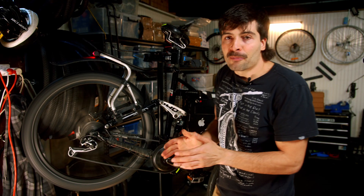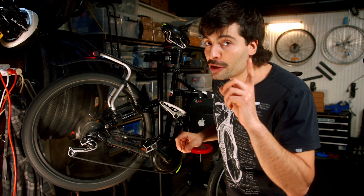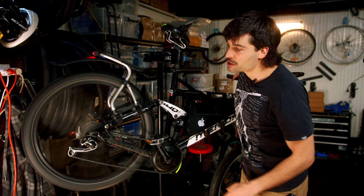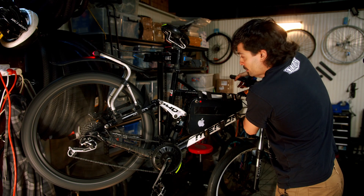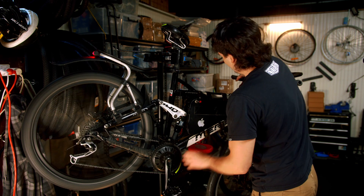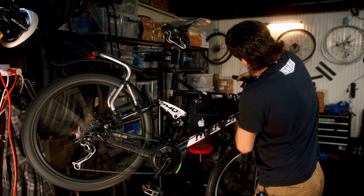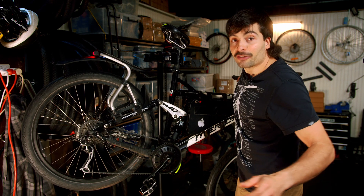If I want to bring the gears back to first because I'm going to stop the bike, I'm going to use the brake sensor. I press the brake sensor just enough to kill the motor, then I start working the shifter — pedaling with the motor killed, shifting, motor killed, shifting.